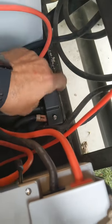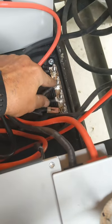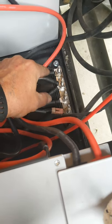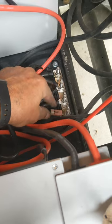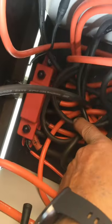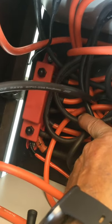This is very clean — you've got one, two, three, four studs. I like the 5/16-inch diameter stud because the cables are built for that, and it doesn't matter what order these cables stack in. We disperse them pretty evenly, and then the positive bus bar is done the same way, hidden down in here, with all the corresponding polarity cables representing the positive.